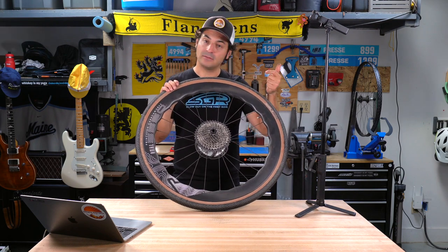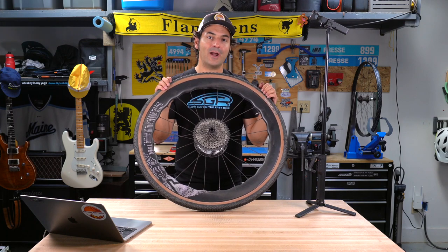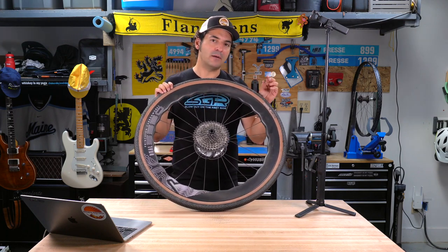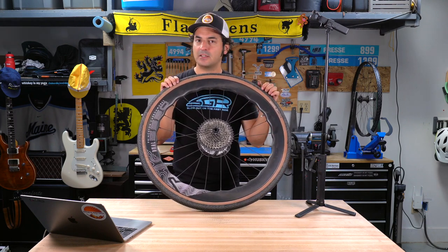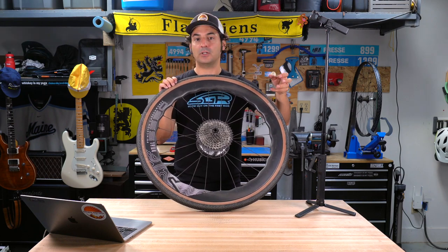This Tactic hub is not quite as grabby and instant as the Hydra hub. The Hydra hub uses a system of pawls that have extra teeth on them, giving you something like 690 points of engagement — that's a lot. Basically as soon as you start turning the pedals, it engages.